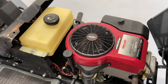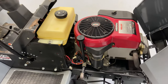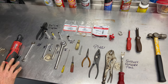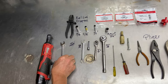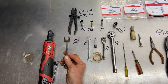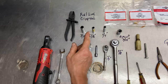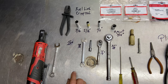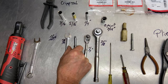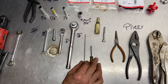The first thing you have to do is drain this. I've drained most of it out to almost the point where there's nothing in it. Tools we need for this: an electric ratchet, a half-inch wrench ground down thin to get the fuel shutoff solenoid off, a fuel line crimp tool from Harbor Freight, 7/16ths socket, 5/16ths socket, quarter-inch socket — all deep — 7/16ths wrench, quarter-inch wrench, a small extension, quarter-inch ratchet, 3/8ths ratchet, and a couple of different screwdrivers to clean with.